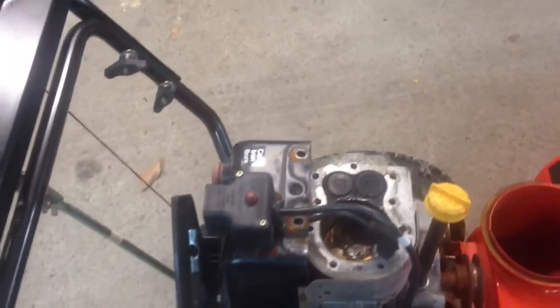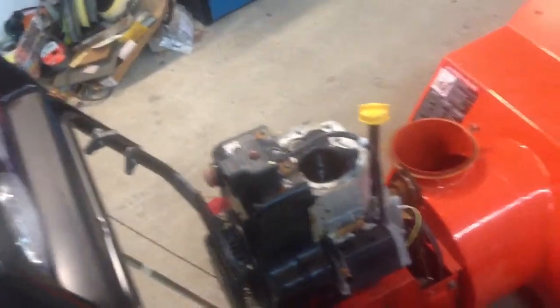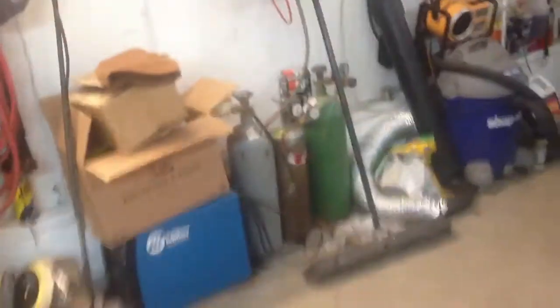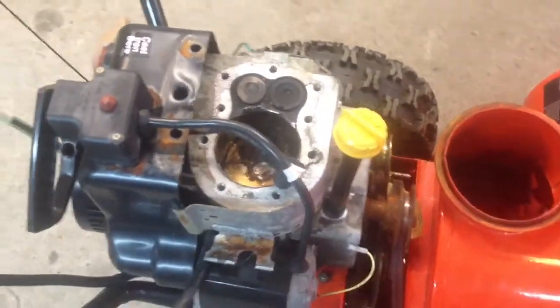Now you're probably asking what happens. Well, this is an 8.5 horsepower Tecumseh engine on a snowblower — Tecumsehs aren't my favorite, and this is probably one of the main reasons why. This broke a connecting rod. As you can see, you can pull the handle. I made a video about it called 'Help, Ariens Snowblower Trouble' — I'll put a link in the description for it. So that was the problem — the connecting rod broke.